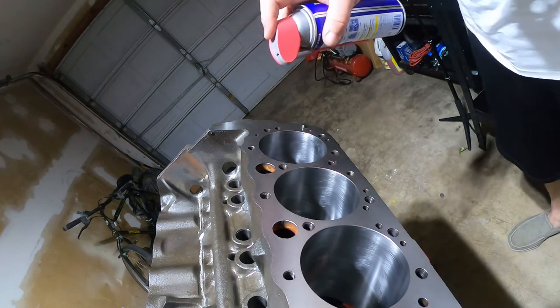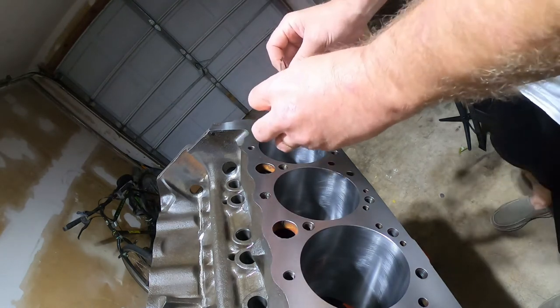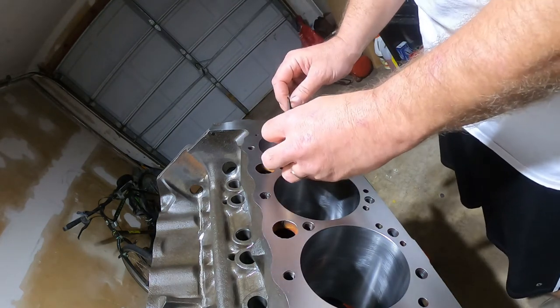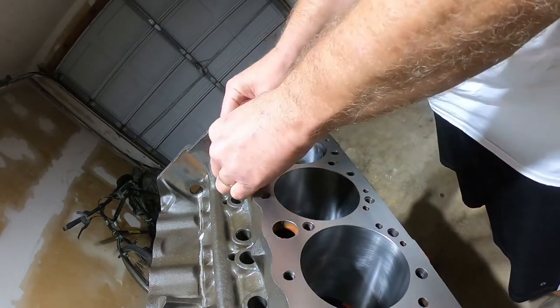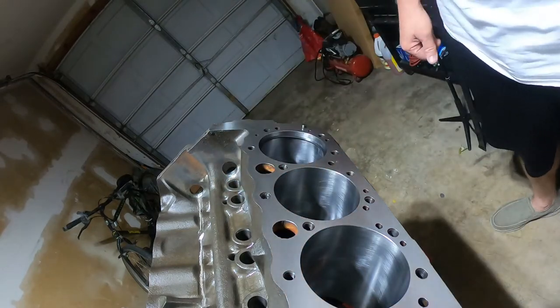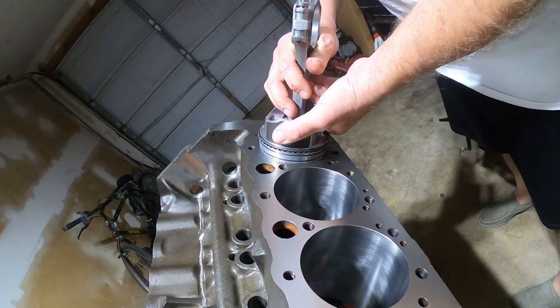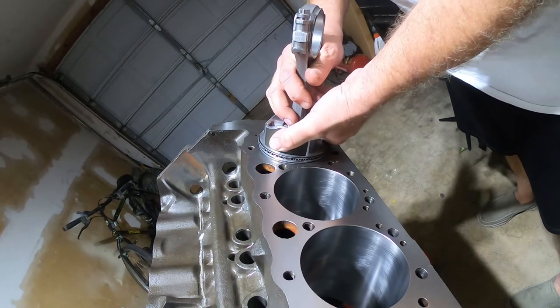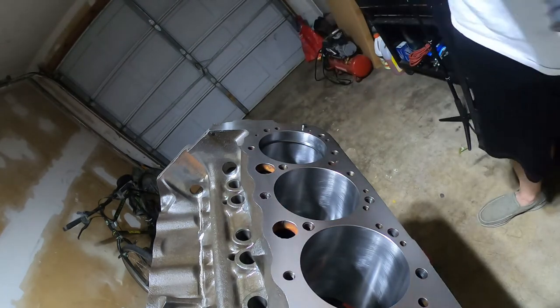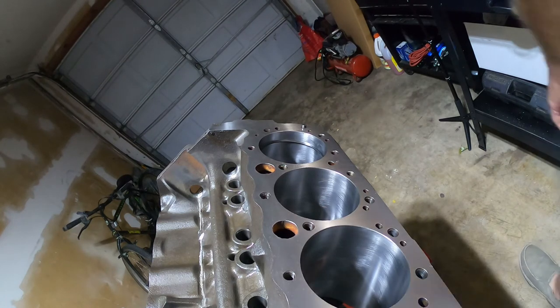First I'll get a little lubrication in the cylinder bore — you never want metal on metal without lubrication. The way to do this: you take the ring and stand it up at the gap toward you, start inserting it in, then roll it until it's inside the bore. Then use an actual piston to square the ring up and make sure it's at an even depth. Gently press the piston in there to square the ring, then take your feeler gauges and check the clearance.